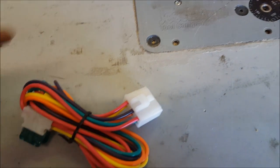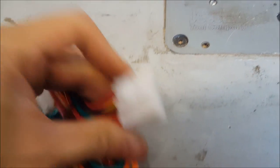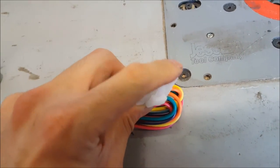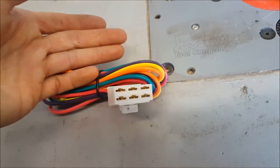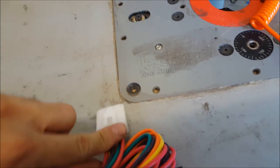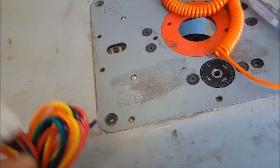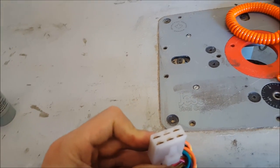When I put on the ring terminal, that was basically where the wire was exposed to elements — that's where I focused the dielectric grease. Now if you're going to do it on the connector side, like a plug in a vehicle, I wouldn't put it inside because it is an insulator and there might be cases where you make it worse. Usually on the inside of these plugs the wires are actually pretty well sealed — that's how the connectors are designed. What might be exposed is the back portion, so put the dielectric grease there where you're not making contact with the other end. Just focus on parts exposed to the elements — don't stuff it connection to connection if you can help it.